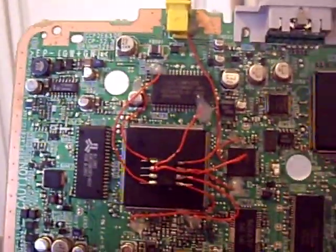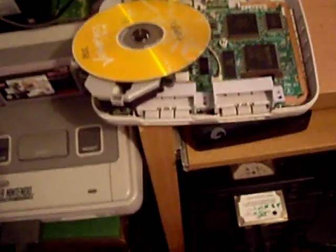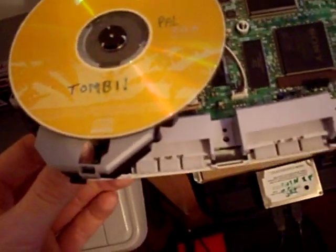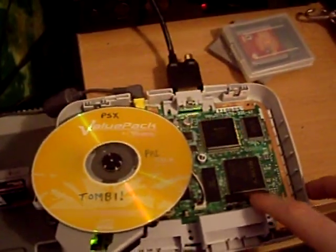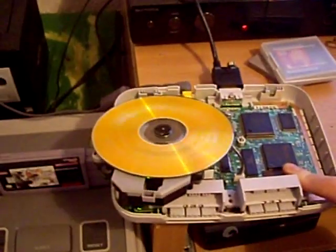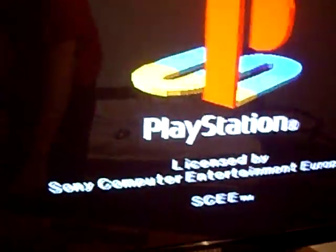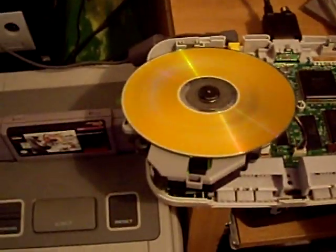Just going to test it — assemble and test now. So I've got it in a semi-reassembled state just so I can test it with a regular backup. This is just Tombi — this is just a test to see if the chip works. If it works, I will put some glue over the actual chip to insulate it, reassemble, and then test it with a stealth backup. Let's power on the unit and hold down the disc close button. You can see it's booting up here and it's reading the disc. And it's booted first time. So we're going to put some glue on the chip, reassemble it, and then test it with a stealth backup — we're going to try Final Fantasy IX. We tested it and it was working with our Tombi backup, but we've just noticed another problem — the same problem as last time, really.